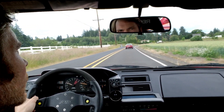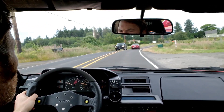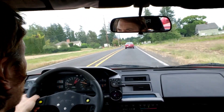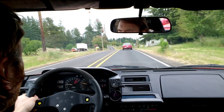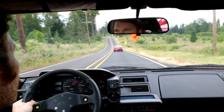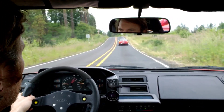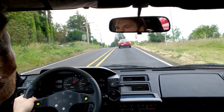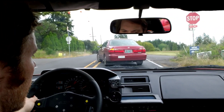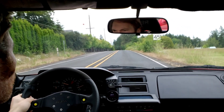It allows a little bit of spin in second gear. The way I've got it tuned is I've also got it varying the slip angle by gear, so it'll allow more wheel spin in first and second than it will in third or fourth. That's good for me because I like to drive it a little bit, but at the same time in higher speeds, if I get wheel spin it gets harder to catch or correct without having an accident. So I like being able to set it up by gear, and I can still vary the slip angles based on the settings on the rotary switch.